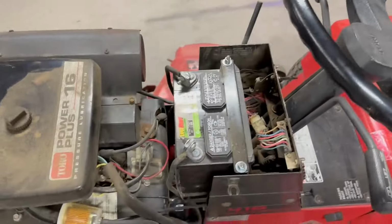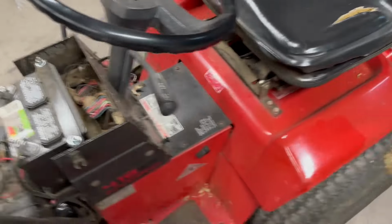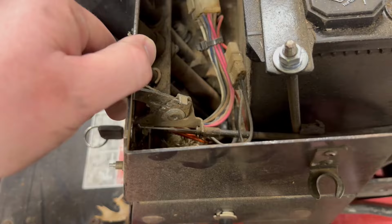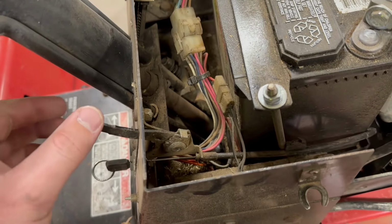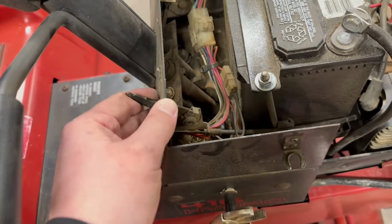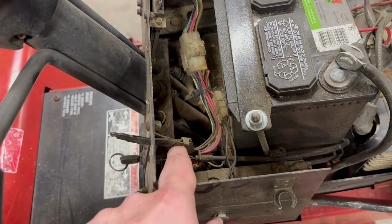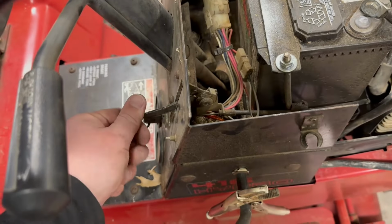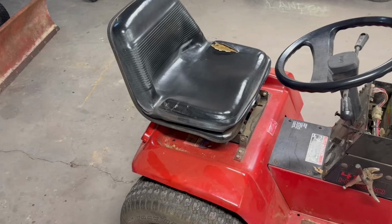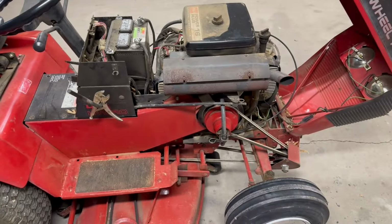One of the main issues I found, not really an issue, just a maintenance item, is that the nylon bushing for the transmission control is pretty worn out. I've got to get some of those ordered. The other annoying issue is this throttle linkage. It's sticking now, but when I'm running this thing wide open, it'll slowly come down and shut itself back off to idle. The previous owner and I always just clamped vice grips on there and held it in place, but I need to fix it right. From what I understand, you can just drill that rivet out and put a 1/4-inch bolt and a nylock in there to make it a little more taut. When I do that, I'm going to replace the knob, just some odds and ends. And like all my other tractors, this one definitely needs a seat, which are, like ag tires, stupid expensive. So it's on the list, just chipping away at it.